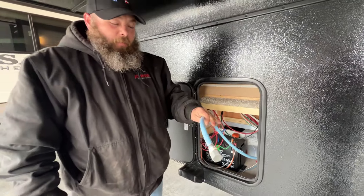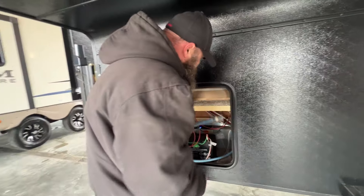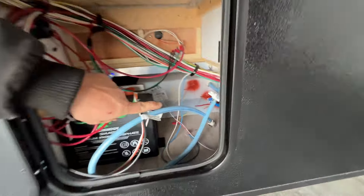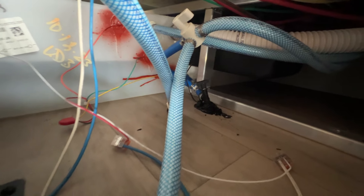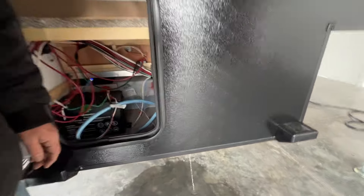This one here is going to be for when you go to winterize your camper. There's a valve right inside here that you would turn, and then from there you're basically using the water pump to winterize. The other valve down here — that black one — is going to be so you can drain the fresh water tank when the tank is empty. Go ahead and pull this guy up and it'll start draining the fresh water tank.